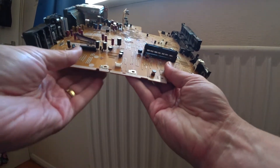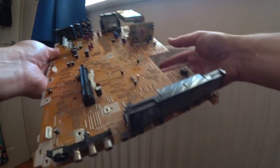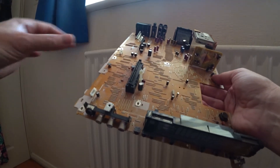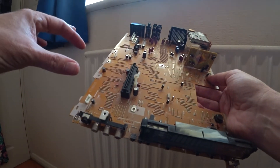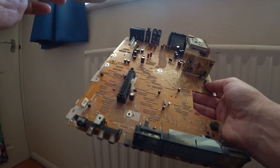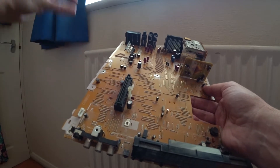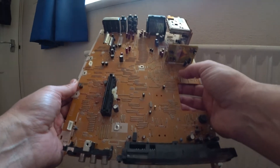I've had to fix that up as best I can, and in the meantime I've been swapping out some components. I had the original little card connected to the DVD drive — I swapped that card out and also swapped the power supplies around, and proved that on the ES10 I've been working on, the card was working and the power supply seems fine. So the changes I've made don't seem to have broken anything.